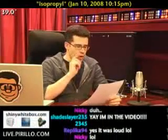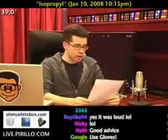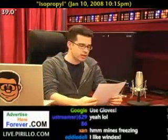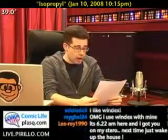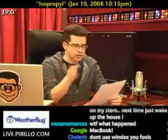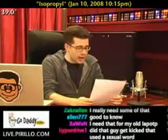So, the number 1 use for isopropyl alcohol: 1. Removing greasy finger marks from laptops. This especially applies to darker colored laptops that make greasy finger marks really stand out. Dilute the isopropyl alcohol 2-to-1 with distilled water on a white cloth. Important that it's white, otherwise the color will transfer to the object you're cleaning. Presto! Finger marks gone. Further, it doubles up to kill any germs that were present on the laptop.